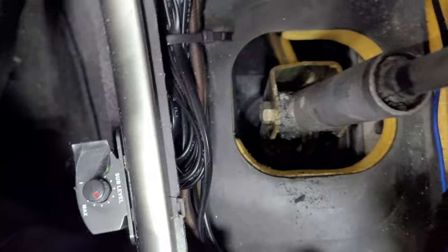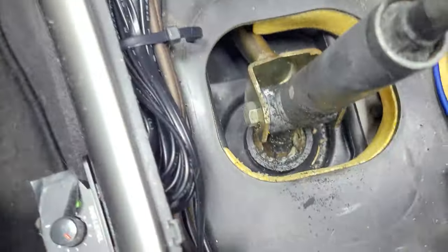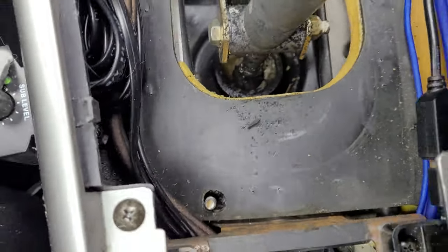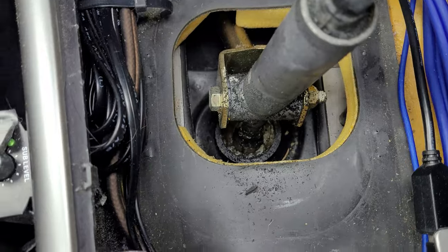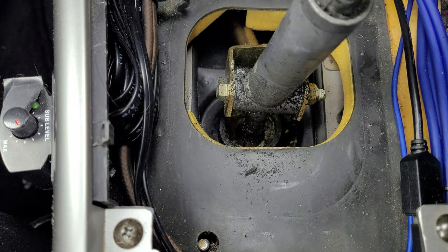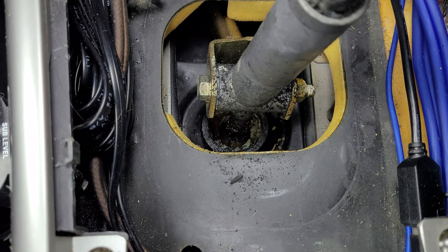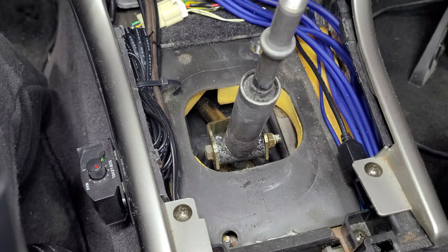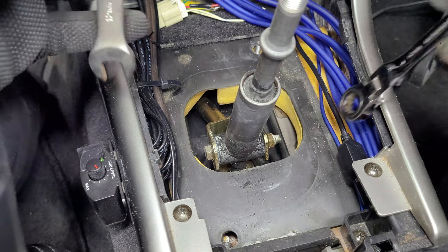We're also going to have to get in there and remove that little ring there. It's pretty greased up — let me get this light a bit closer. Yeah, it's pretty greasy in there. You're supposed to use C-clips or snap ring pliers to take that out, but I'm going to see if I can do it with just some regular pliers. If not, I'll make a run to the hardware store and pick some up for about $10 or so. First thing I'll do is just remove this bolt and get this shifter out of the way, so I'm going to grab two 12mm wrenches — one of them is a ratcheting wrench to make this easier — and get in there.